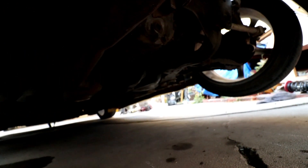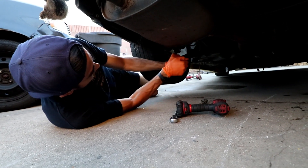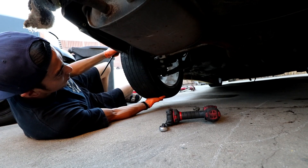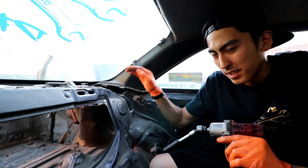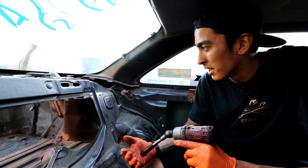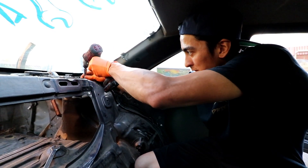We've got Maya right there cleaning up the old tire marks. For the rear coilovers, they're pretty easy to install too. There's a 17mm bolt right here holding the bottom of the coilover to the rear knuckle — same on the other side. Once you take off that 17mm, just get a screwdriver and pop it off. You'll see the rear suspension just drop because nothing's holding it — and that's it. The backs are kind of a pain, and it's hard to see with no light, but there are two 14mm nuts holding each rear coilover to the car. Ideally you'd want somebody under there to catch the old suspension, but these rear coilovers are cheap so I'm just going to zap them off.